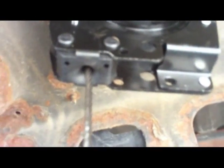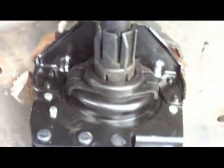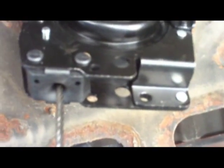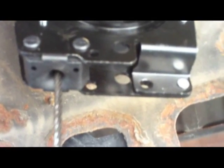Most of the work was taking that bolt off that was pretty rusted on there. So just be cautious not to break that bolt, and put lots of oil, back it off, push it in, back it off, push it in until you get it all nice and loose. And then oil it up before you put it back in. Like I said, I'll report back on the video, but it'll probably be a day or two or a week or two after I put the spare on, to let you know how it works.